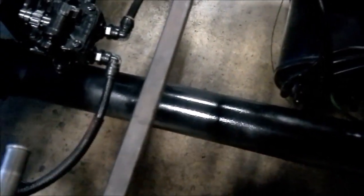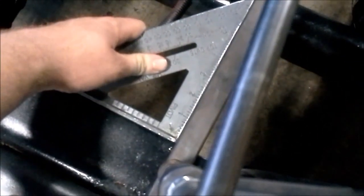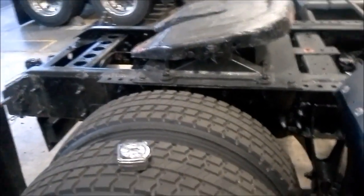Make sure the beam is 90'd out, centered, and undamaged — otherwise it's going to throw off your alignment. Take a tape measure. What you're going to be doing initially is measuring the distance from the tip of the steel beam all the way to where the white dash is on the tire. Measure on the other side too. This measures the true thrust angle — the angle of the axle to the frame, squaring the axle up to the frame.